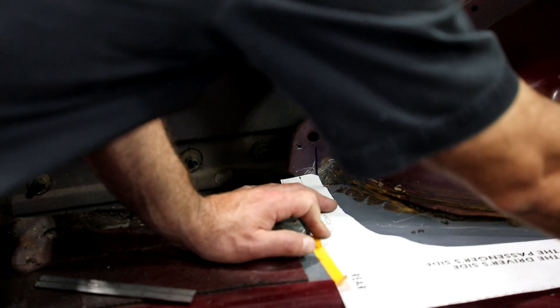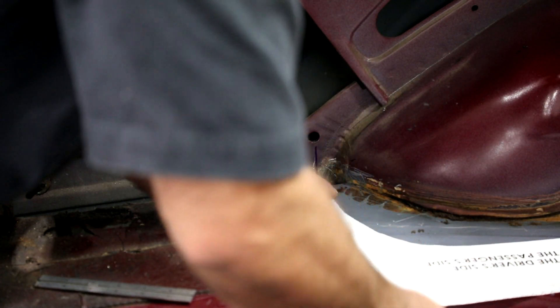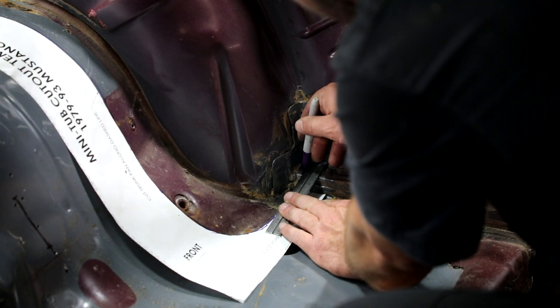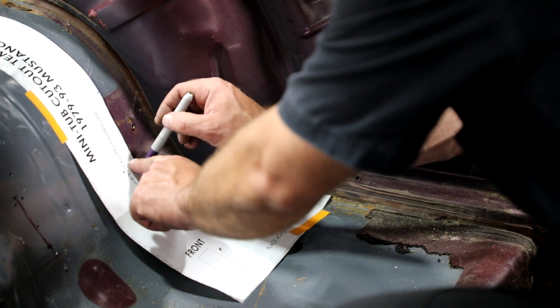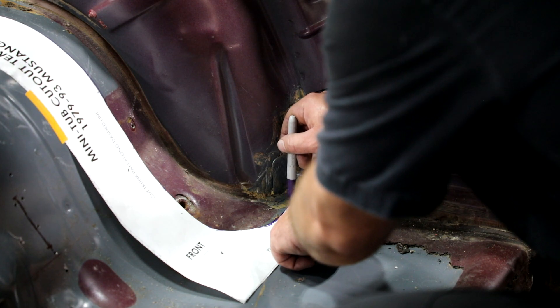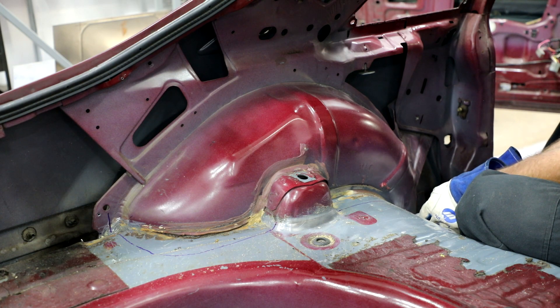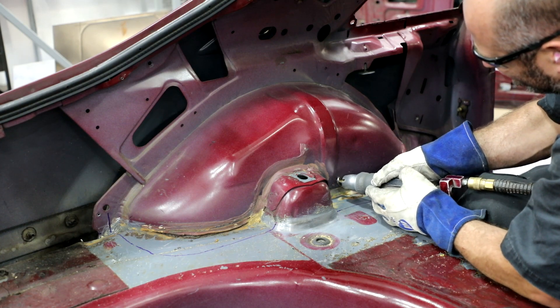Place the template on the trunk floor with the rear edge of the template against the rear flange of the outer tub. Line up the template with your reference line from the previous step and tape it in place. Also tape the template in place around the upper shock mount. Locate the front edge of the template against the reference line inside of the rocker panel and tape it in place. Draw a cut line on the trunk floor along the dashed line of the template. If you use the cut out template as directed, this will take the mini tub to the outside of the frame rail at the rear of the wheel opening. The mini tub has extra length if you want to do a custom install that will cut into the factory frame rail, which will require boxing in the frame rail on the inside.